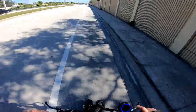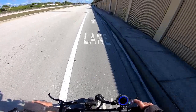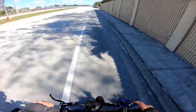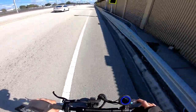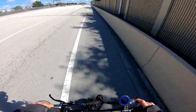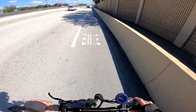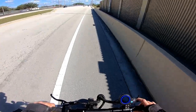After taking apart the Dualtron back tire, the way they handle wheel construction with scooter tires is awesome. It's so much easier to change a tube compared to an EUC. You basically just take off a plate that makes the tire come off without effort, put the tube in, put the plate back on, and the plate is what actually seats the tire back onto the wheel. It's so easy. I'm really surprised no EUC manufacturers have tried to duplicate that setup because it makes changing tubes and tires almost trivial.